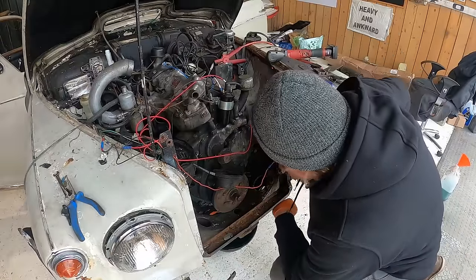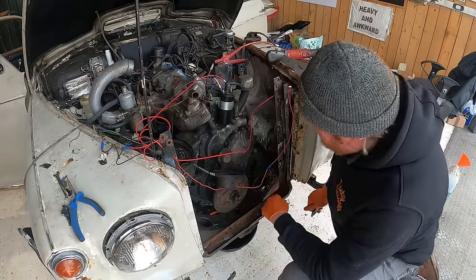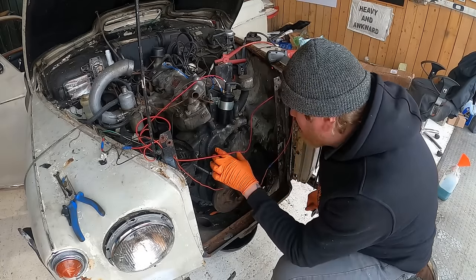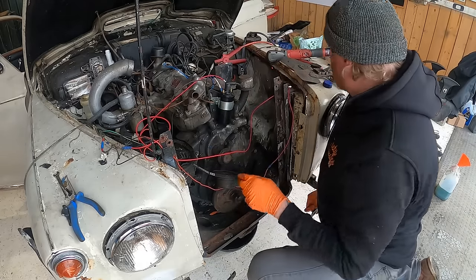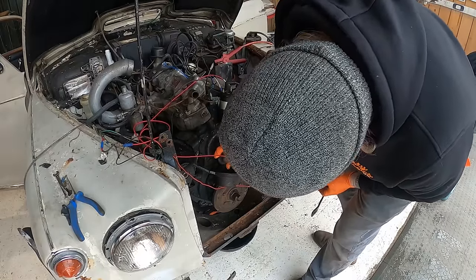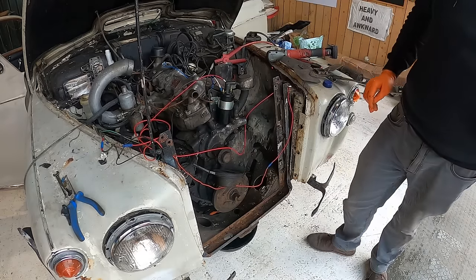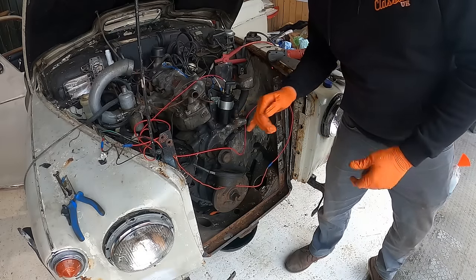So, what does this water pump look like? Another's wet there. Yeah, I think it's going to need a water pump. That is very, very frustrating. You can see just in there, it's a bit wet. Wet with coolant, I think. Yeah, so you can see when I'm moving it, it just drips a bit of water from the cooling system. Just like that. So we need to find someone that can overnight me a water pump.